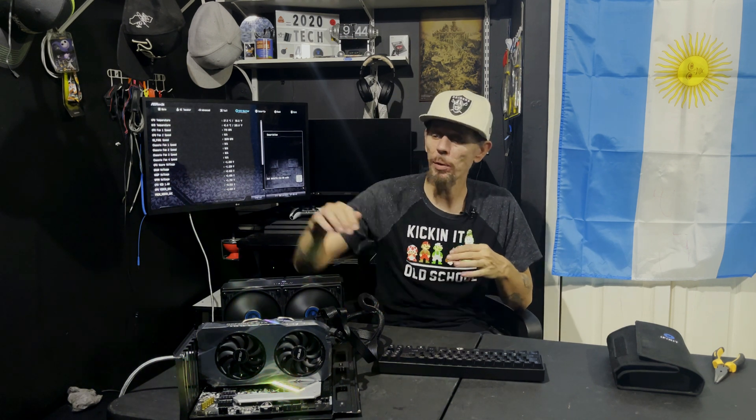If you don't have your back plate, notify IceGiant — it looks like they produced a quality product here. Everything inside the box was packed in thick foam so you don't have to worry about anything being damaged. In the packaging was everything needed for Intel, AMD Threadripper, and AM4. It even came with its own screwdriver so you can reach the bolts from a distance. It was good that the fans weren't pre-installed because we wouldn't be able to get to those bolts otherwise. Everything was packaged in easily identifiable bags. Installation is pretty simple: original back plate, a couple of standoffs, a big bracket, four screws, throw this on top, tighten down, put on your fans.